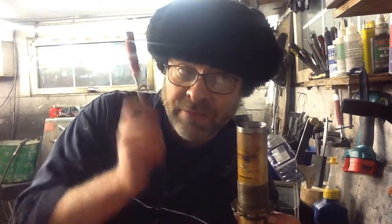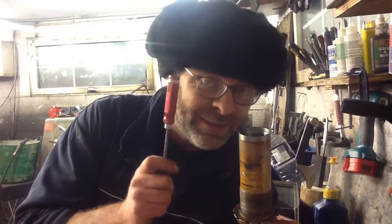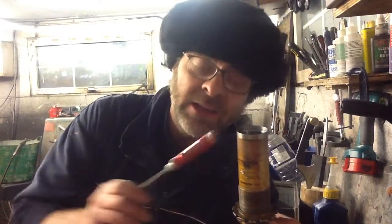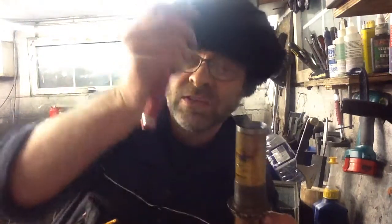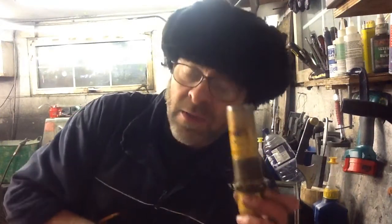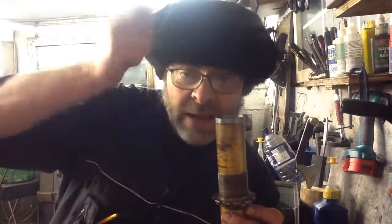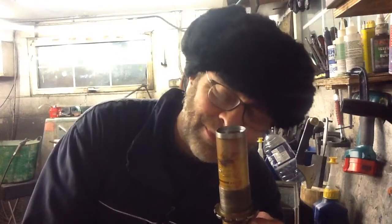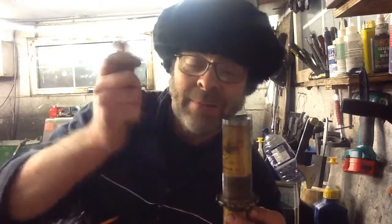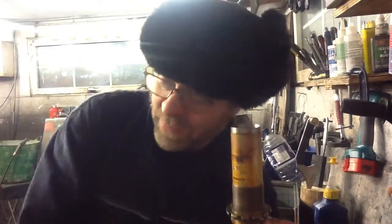But there is a front BMW shock, it's like an under licensed WP unit, and it's the only one where all this is removable and all the internals are held in by a circlip. They're quite easy to spot. One, this metal is folded over and hammered, although it's probably done on a press, eh? Hammer, hammer, hammer, hammer. The other one, everything is inside with a circlip, and then what you have,